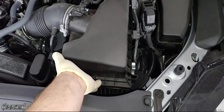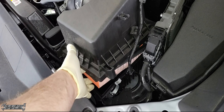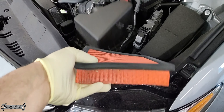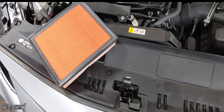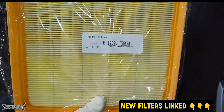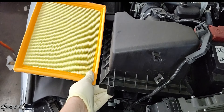In the back there are two tabs in little grooves. You want to gently lift the front end up and then pull it straight towards the front of the vehicle to get those tabs out. Then you'll be able to lift the housing up a bit and grab your air filter and snake it out carefully. It's not the most spacious, but that's how you do it. Here's the Toyota part number — I'll link the filter below.